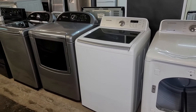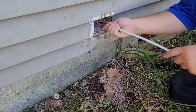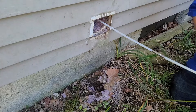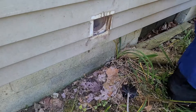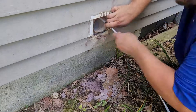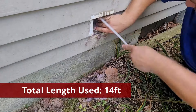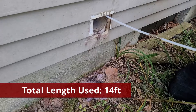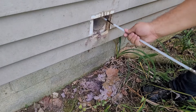In the end, if your dryer isn't getting the clothes dry, it's a telltale sign that something is obstructing the hot moist air from leaving the dryer and venting outside. A cleaning kit like the one I used in the video is a fraction of the cost of a repair call or a new dryer, and once you clean it you're going to realize how much better your dryer runs going forward. If you need a brush kit like the one I used, it's linked in the description. I hope this video helps you out — if you liked it, subscribe for more. Have a great day!